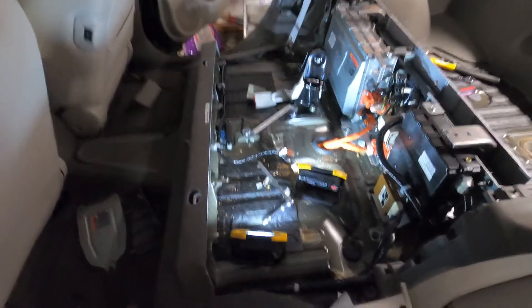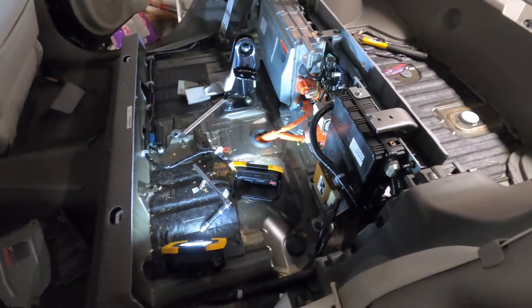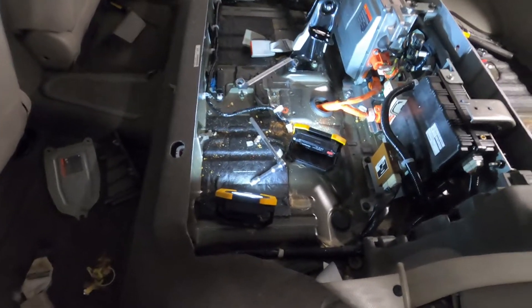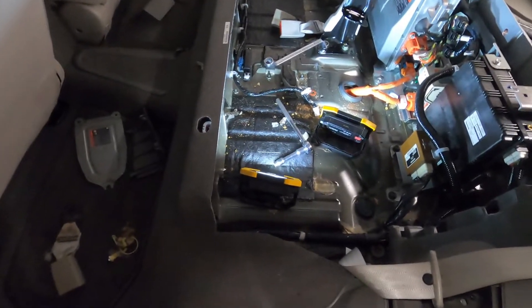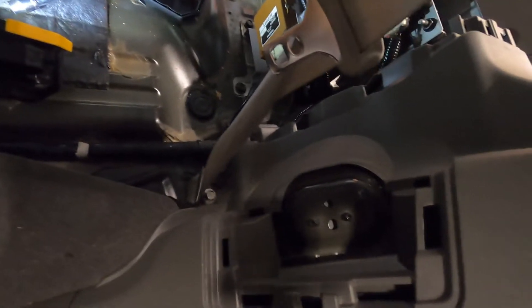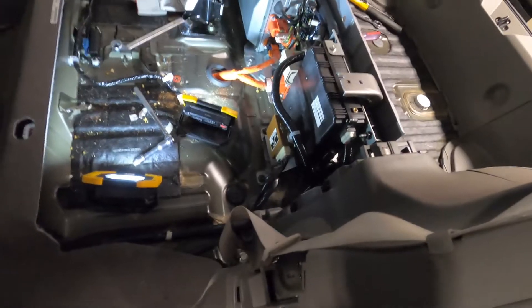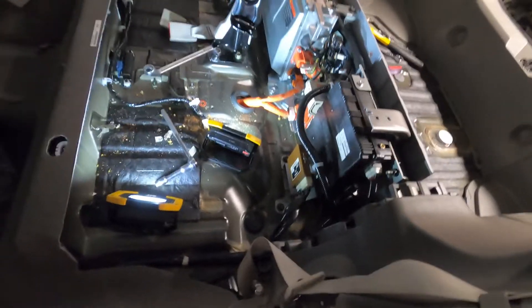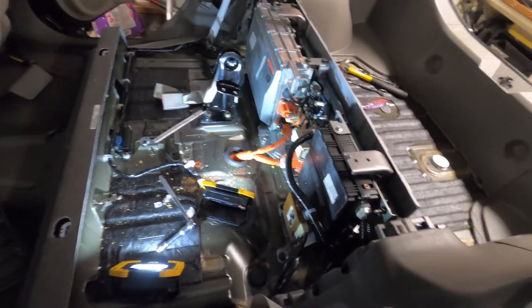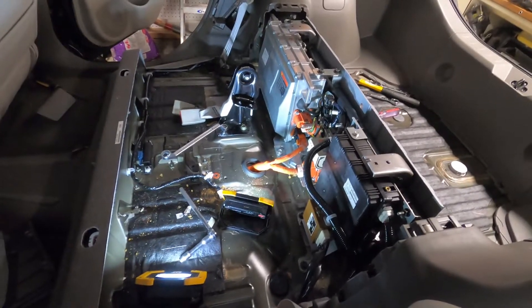Update time — this is actually very easy to get into. Worst part: those big bolts on the back of the seat are extremely tight; we actually had to take a hammer to crack them loose. But other than that, not bad. The seat bottom: on the front of the cushion, stick your hands about where those holes are and give a good hard yank on both sides — it comes right out. There are 13mm nuts on each side after you take those little clip panels off, which pop off fairly straightforward. The seat belt anchor in the middle we had to take off — we left the bolt in the anchor so we'd know where it went.